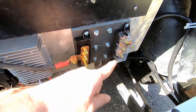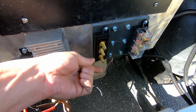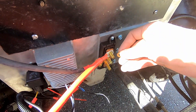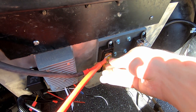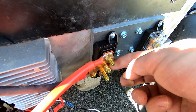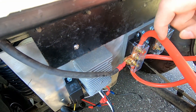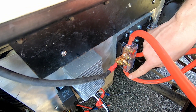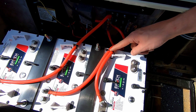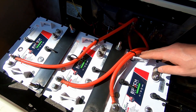Just something quick I've noticed. Installing my terminal blocks — on this terminal block you have to take all the bolts off, remove the bus bar, and grab a couple of these washers. The way you put the cable on is you put your cable, then a washer, then a bolt. You're going to want to have the lug pushing up against the bar itself — that way you have the best connection. Positive wires run, and you can see they all go into the block. This is the cart positive, and then one, two, three positives on the bus bar. I just laid them out nice to see what worked. Using a zip tie to hold these wires so that they're not bouncing around and rubbing on anything — I thought that was a neat idea.